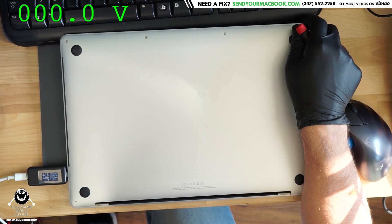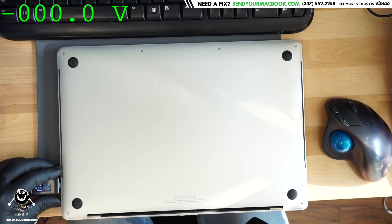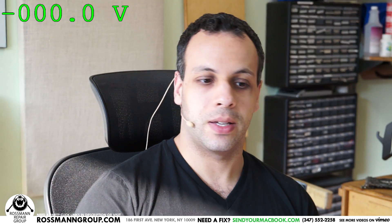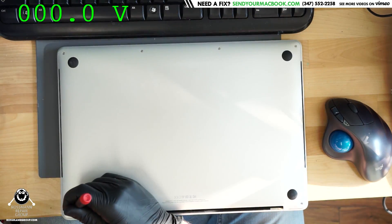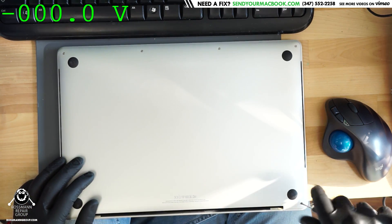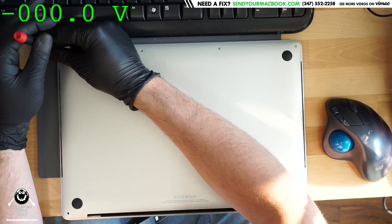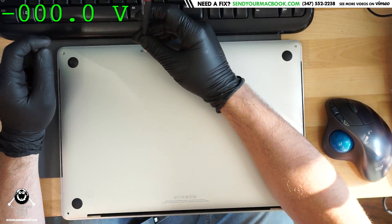Here we have a MacBook that won't turn on. When I plug in the charger, it takes 5 volts at 20 milliamps. It never reaches 20 volts like it's supposed to. It's like somebody who has 830,000 subscribers on YouTube should have a real studio or proper lighting, or a store that's not next to a large window where when the light comes in, it completely destroys the visibility of my face. But such is life. We're going to open up this little MacBook and see what we can do.